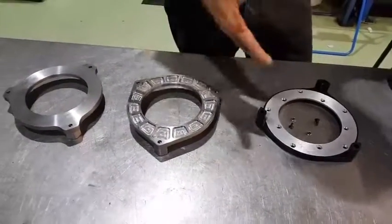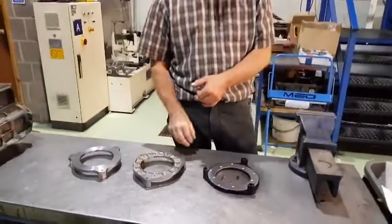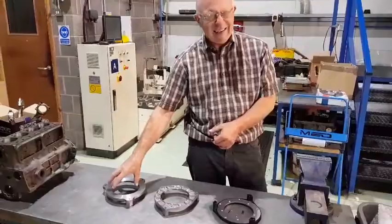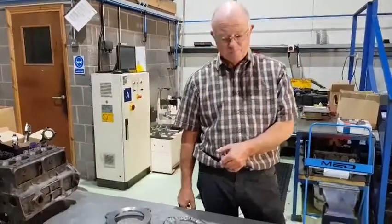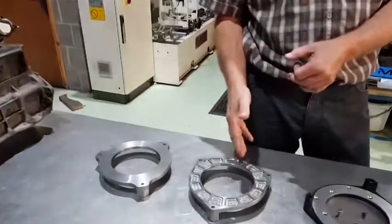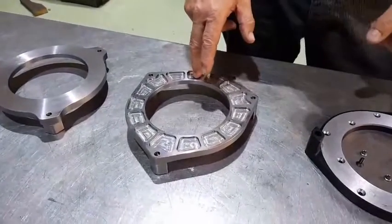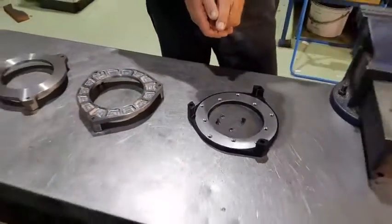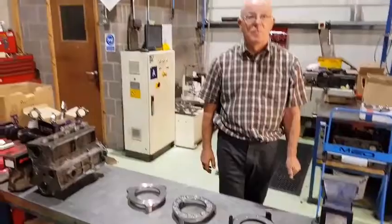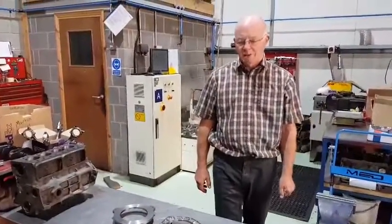I would push it more toward the racing end than halfway. So in summary: EN8 for road use, EN24T for where alloy is not permitted such as historic racing, and the 7075 alloy for the ultimate. Thanks, Steve. Maybe next week we'll take a look at the flywheels again — the different range and how these match up, see how they compare with each other. Thank you.